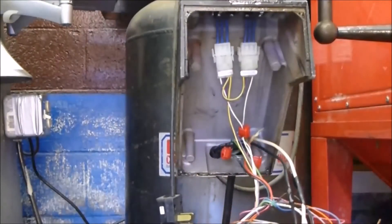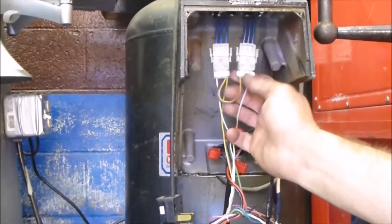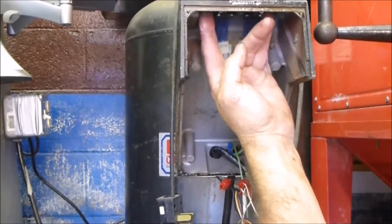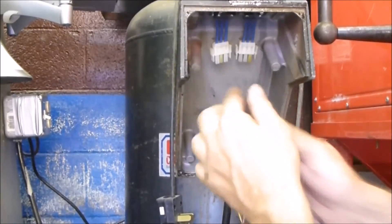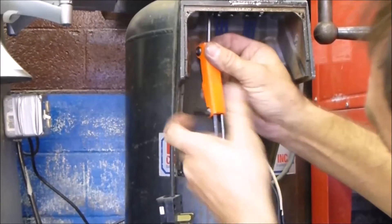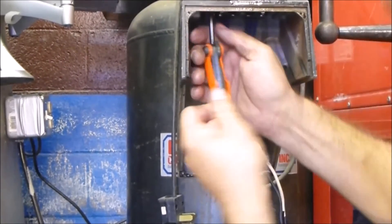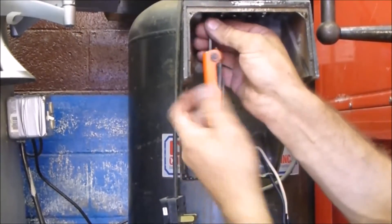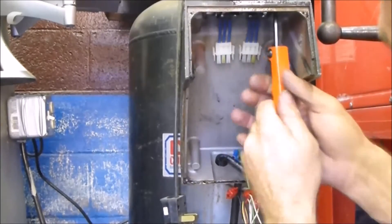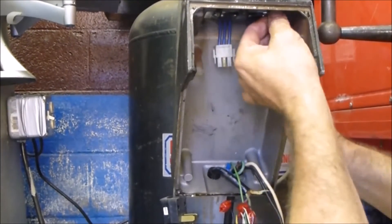What I had to take off is just these top two screws and these bottom two down here, and this lower assembly comes off, exposing all the connections and all the wires. In order to move this out of the way, you've got the left and right switch connectors — go ahead and disassemble those. There are two allen screws holding this bottom part in place. Make sure you unplug this before you start working on these electronics. I don't want to mess with live electricity, especially if I've got oil all over my hands — I don't want to zap myself.